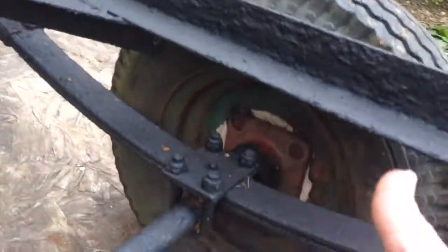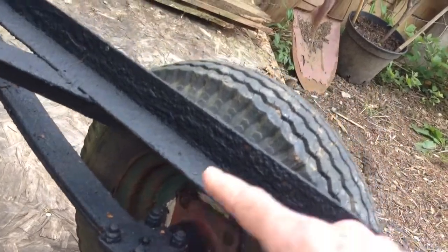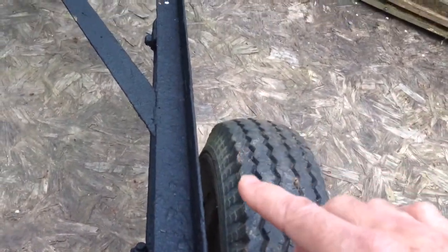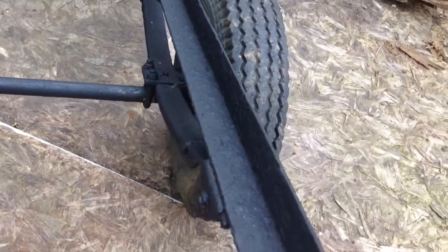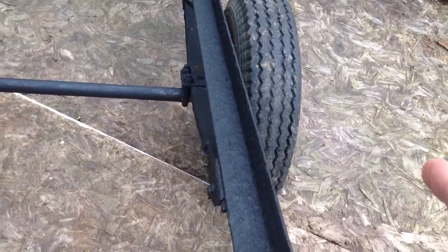Although it would need mudguards to make it absolutely road legal. Alternatively, because you've only got a limited amount of springing here — probably a couple of inches — you're not going to have much of a rise. So you could build up simply by extending up here a little bit and coming over. You could widen the trailer without widening the wheel distance.